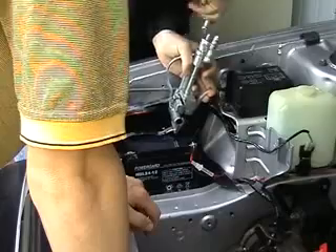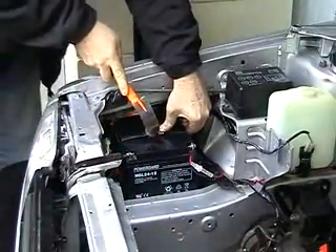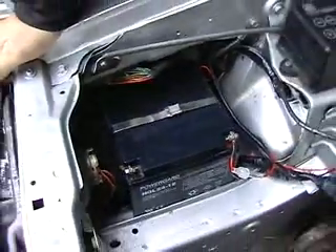This is the recharging system I have so far. I've installed a recharging socket and a recharging plug. I've also installed an ignition blocking relay so that when I plug the charger in for the car to recharge, it kills the ignition. Not only that, but the turbo timer I've installed goes into standby mode, which will be connected to the rear ventilation fans. And the recharging light on the dashboard fires up — how cool is that. It's another thing ticked off the list.